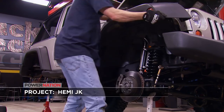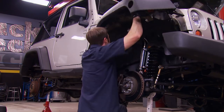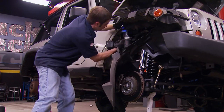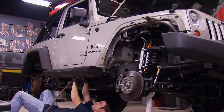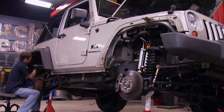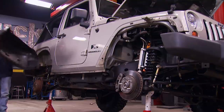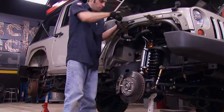After removing a few bolts and disconnecting the wiring harness for the light, you can start prying the flare away from the body. Just make sure you get every bolt. Now the popping noises you hear when pulling the flare off is the factory retainer clips breaking — no big deal, they're not reused. Any leftover broken clips left in the holes need to be removed.